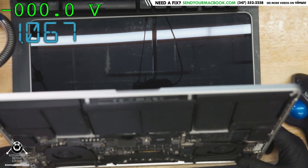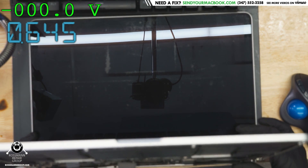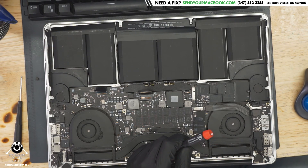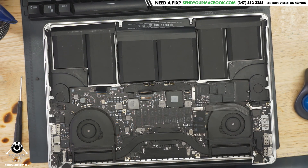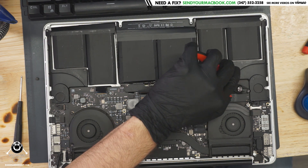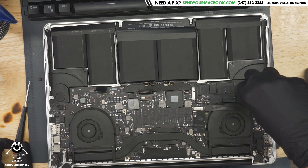This just needs a u8900 and it'll work. We'll get approval for that and go on. At 600 milliamps it should be booting. This screw is stripped, so I'm going to try to put a T6 screwdriver into the T5 hole and see if that lets me remove it. That screw is so stripped that nothing's going to remove it — so let me show you a trick. Using Xcelite 175M fine-tip flush-cut snippers, you grab under the screw and then twist.